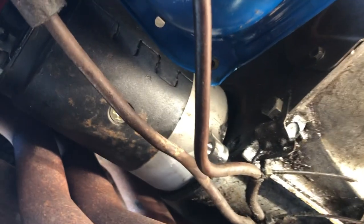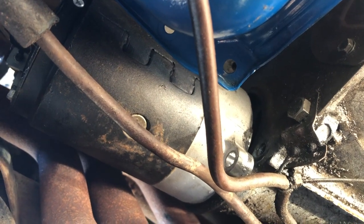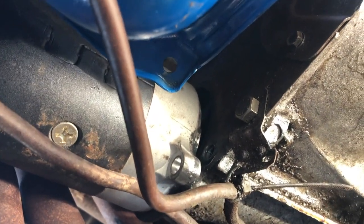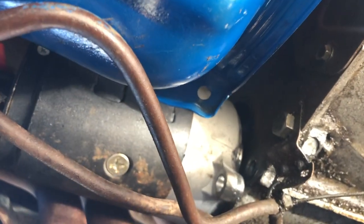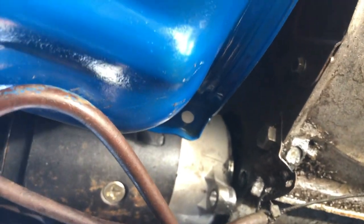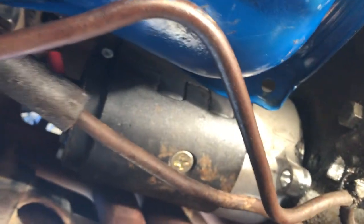I'm taking the starter out right now. I was able to get the oil pan out with it in, but with the gasket on the oil pan I don't want to be rustling it back in. So I'm going to pull the starter off to get it out of the way. It's kind of funny because replacing the starter was the very first thing I did on the Bronco — I had just bought it, parked it in the neighbor's lawn temporarily, and it wouldn't start, so I had to run out and buy wrenches and figure it all out.